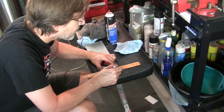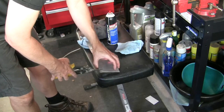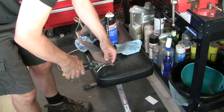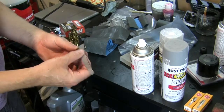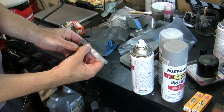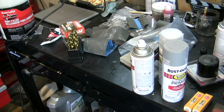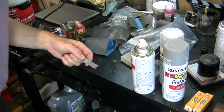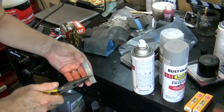Straight edges come in many forms. Okay, so a little piece of metal has to go around this thing, plus a little to tack onto. So maybe that much. It's got to go all the way around to here, and I'll mark that to that length. And one way to get the exact length is to bend it right on that line.